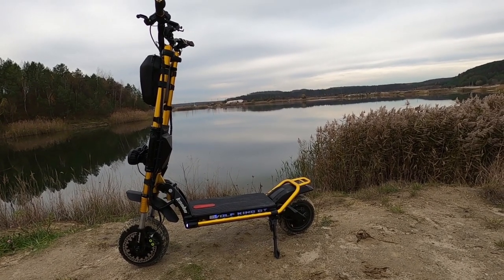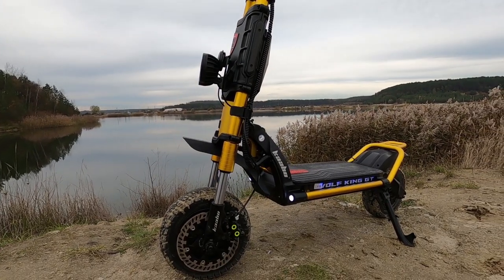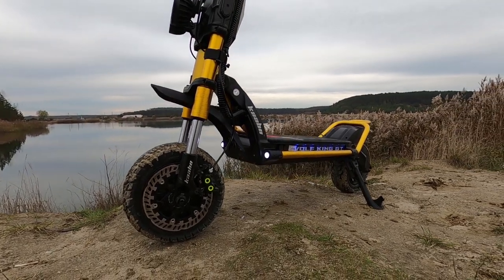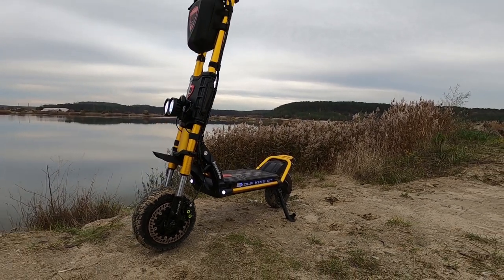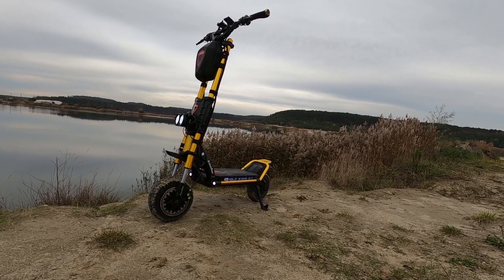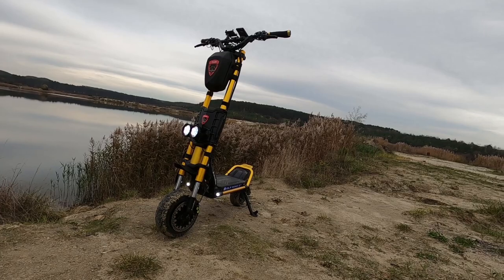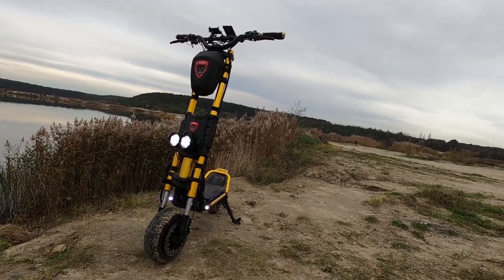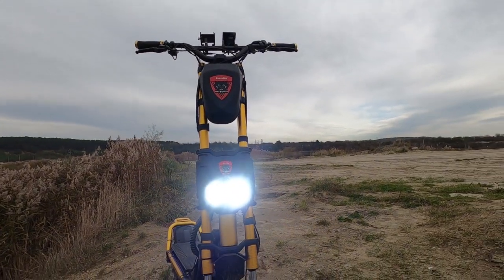Basically, my e-brake works only at higher speeds when the scooter is kind of warmed up, when it's been running a little while. Doesn't work really at lower speeds at all, and there's very little difference. There's no subtlety in the modulation, the amount of e-brake. It's like an ape grabbing you and pulling you back regardless of the level.